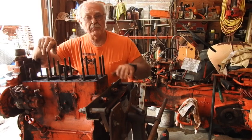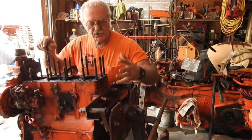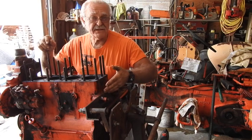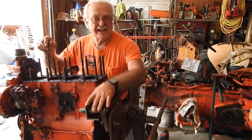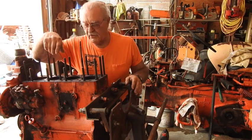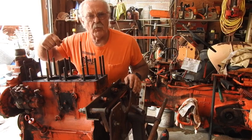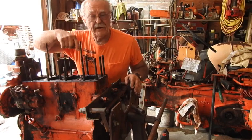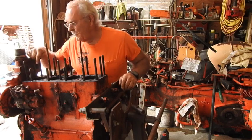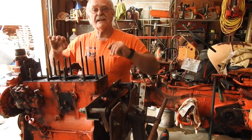We got the engine up off the floor and went ahead and bolted it to the engine stand. There's always a little problem — this one here was no exception. Instead of having four bolts on the back end that actually bolt through the housing, this engine actually had two studs. So I had to stop and make a plate to adapt from those studs to where I could mount it out on the outside edges so we could securely get it onto the engine stand. We're ready to turn it upside down and drop the pan off and take a look at what's in there. I went ahead and pulled the drain plug and pulled out all the nasty oil. There was a little bit of water in there. The fuel that I dumped in cylinders two, three, and four — about an inch and a half or two inches deep — that's all disappeared and gone down around the rings and ended up in the pan. But number one didn't budge a bit. I do not believe the level dropped one bit.